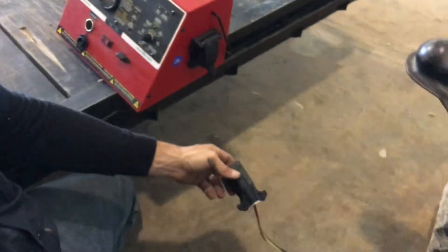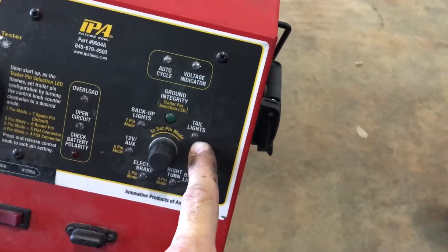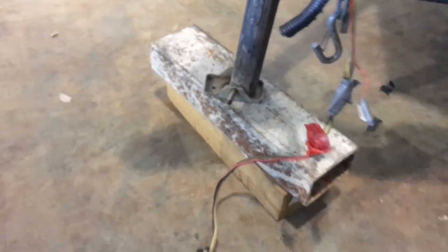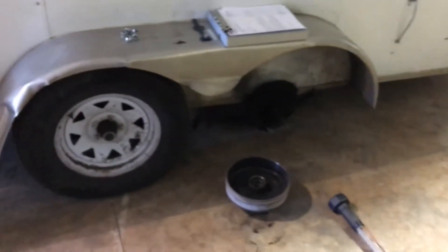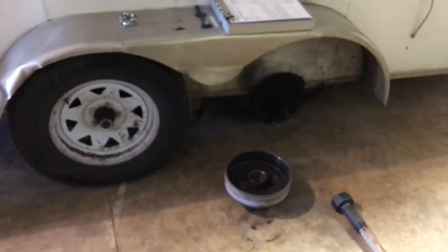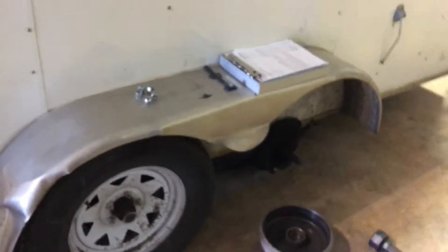What this means is they've reversed the plug. As soon as they kick on the taillights on their truck, the taillight post — the top left pin circuit inside the plug body — comes hot. That's lining up with the electric brake circuit on the trailer, causing the trailer brakes to come on hot while driving. Somebody knew they were having issues because they cut this red wire hooked up to the electric brake post and put tape on both ends. That's what caused this hub to get hot — at nighttime running, that taillight circuit engaged the brakes continuously.